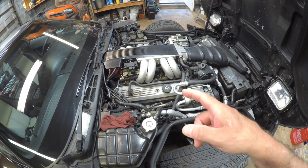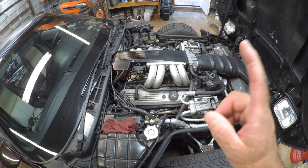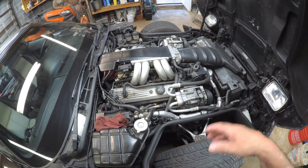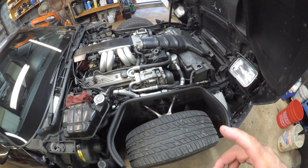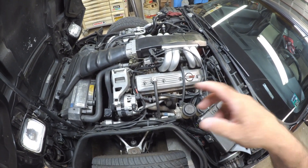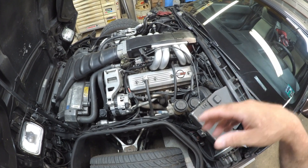This is not a stock motor — it's a 383. I left a link in my last video. It basically pumps a lot more air, so originally I stuck a PCV valve from a big block Chevy in there. That worked real well except at idle it was passing too much air. Cruising and whatnot, it worked great.